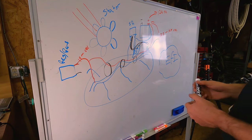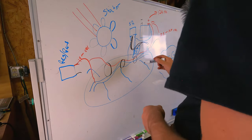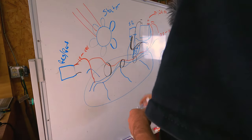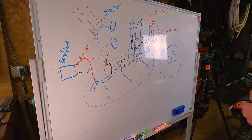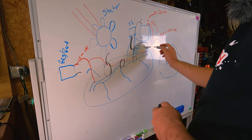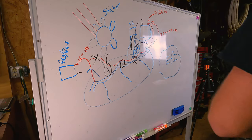You do the same thing on the negative side. In the stock wiring loom there's only one ground connection and it's way up by the steering column. I added two — one from somewhere in the middle directly to the negative pole of the battery, and another up on the neck grounding out to the frame. That gives you a much more complete system. The alternative is to go down to the Beta dealership and figure out the part numbers for the wiring loom for the 2019.5 and up — better call it 2020. It's the efficient loom. Some dealers may not know about the part number switch, so make sure you get the right one. They've actually eliminated the diodes, eliminated the need to fix all these connections and add extra wires, and built the thing right.